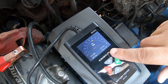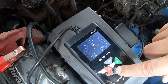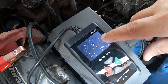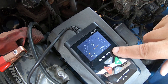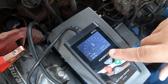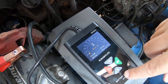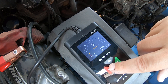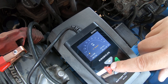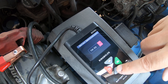Voltage has dropped to 11.99 volts. Going down to state of charge, it's showing zero because a fully charged battery is considered 12.6 volts and this battery is already down to 11.9 volts — it's not happy with that voltage. We haven't had any problems starting the vehicle, but more than likely when winter comes in a few months we'll probably start seeing some problems.